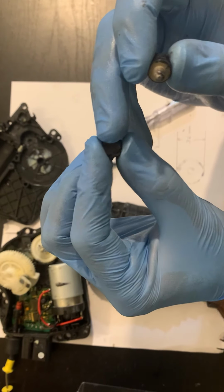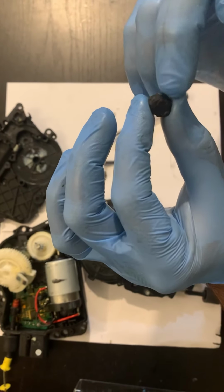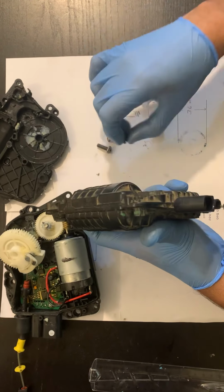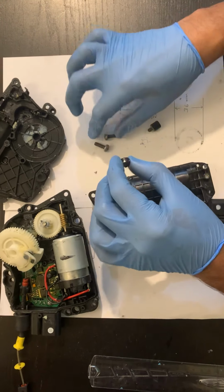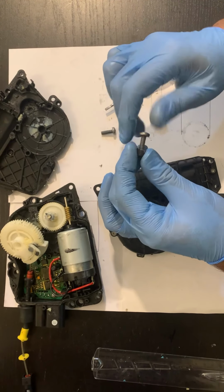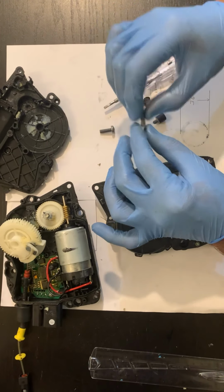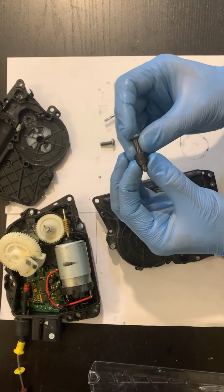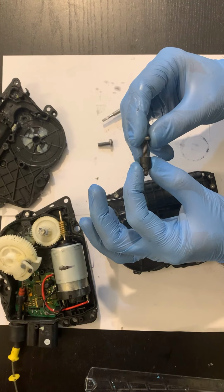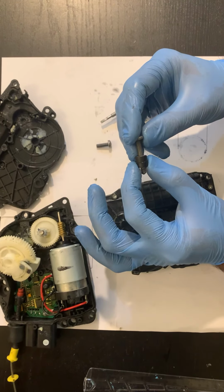If you hear the sound of closing and if the door is not closing by itself, then this is the cause. So what you have to do is just remove this particular bolting system. Just take it out. Like, this is the bolting system. Just take it out and replace it with a longer one. Longer means at least of this size. I hope it is like 5. I will just measure it.